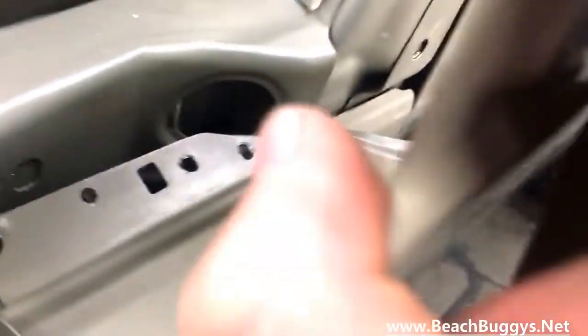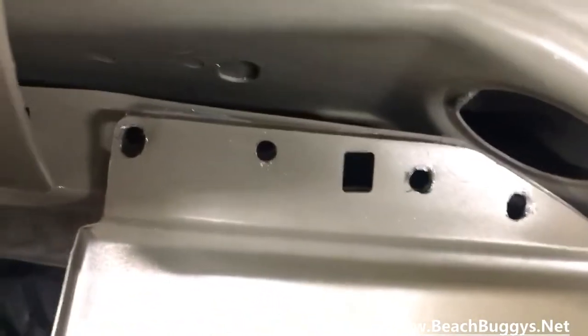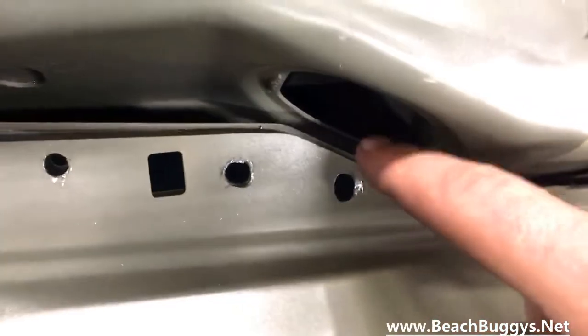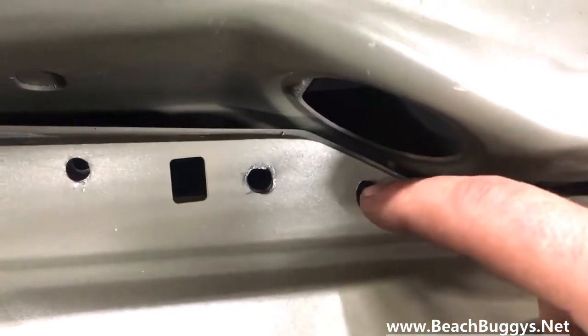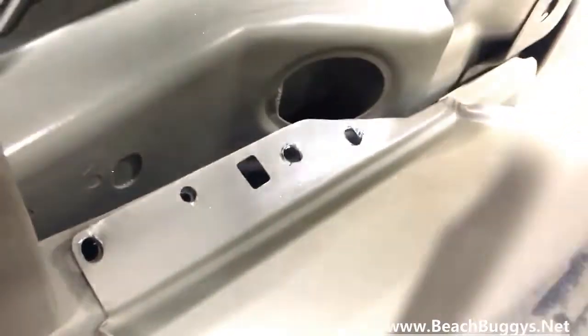All right, taking this cowl cover off, you're gonna have to bend it a little further than it seems comfortable to do. But what you want to do is hit these 4 weld spots. You see, I'm off just a bit right here, so I'm just kind of angling it, walking it off. But the rest is broken free. I just wanted to show you before I pop the last one off basically what you're looking for there.